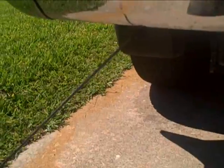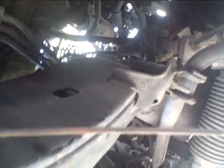And where it comes out on each end, I'll get some of that covering plastic stuff and put around it. Well, hopefully you can see back there, I've got the wire tied on. And that's the hole I used. That was the one I tried to use, but about right here, there's a block in the frame, like you can see one right there. I couldn't get the tape through there. So, all we gotta do now is just pull this back through. We have to twist it some, but just pull it back through and it'll pull the wire through.